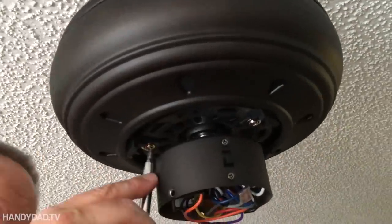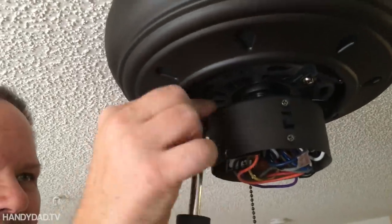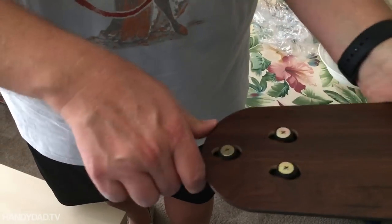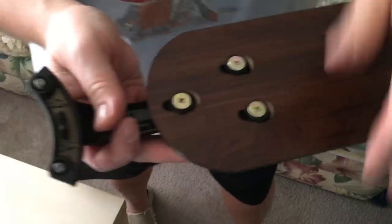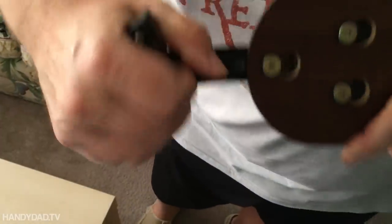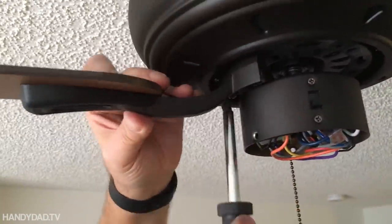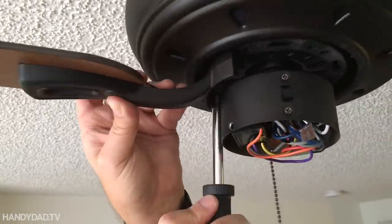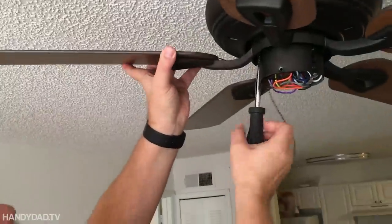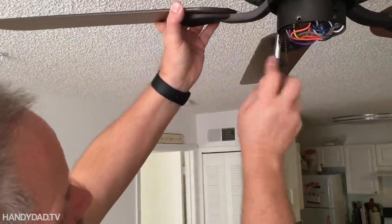Here I'm removing the temporary braces that held the motor during shipping — I won't reuse them, just throw them away. This Hampton Bay fan has slotted blades for quick installation. There's a spring latch that keeps the blade in place, no need to touch the screws. I like to use a manual screwdriver with fans as opposed to a cordless drill for two reasons: I have more control by hand so there's less risk of scratching the fan, and I don't want to over-tighten the screws because we'll be moving this fan at some point.